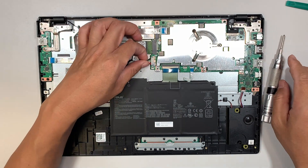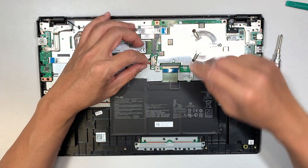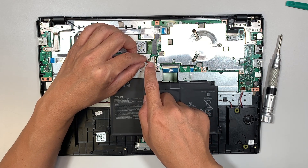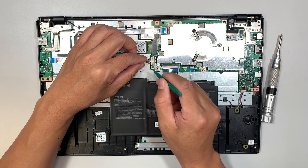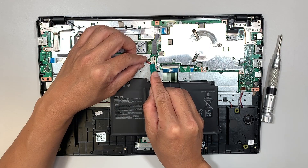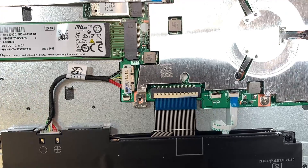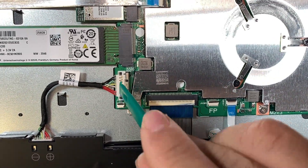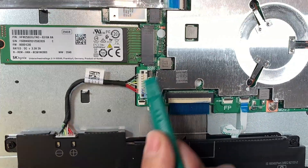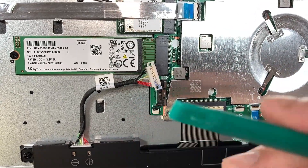To remove the battery, all you have to do is push this metal bracket down. There's a clipper that clips onto the connector. This position is locked — all you have to do is push that metal clipper down so you can pry open the connector straight up. The connector goes straight up once that clipper is open.